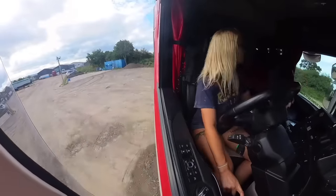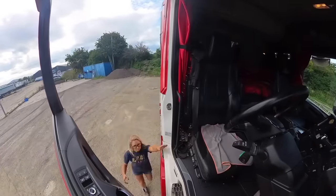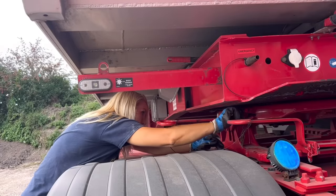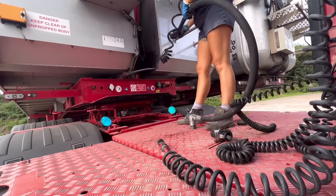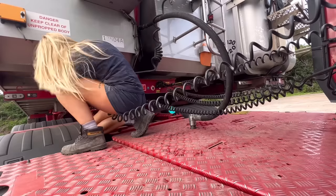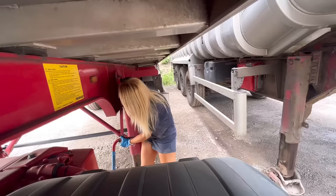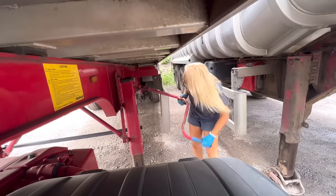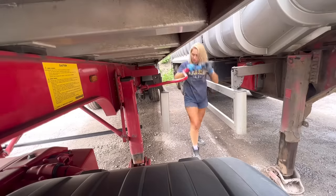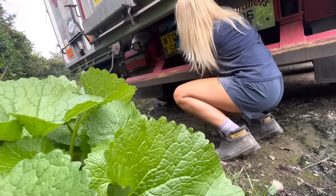I find my trailer at the yard that I dropped this morning, and although you can't see it, it is definitely behind me. As always, I get out to check the fifth wheel height, and then I can reverse back onto the trailer. I do up the clip. I connect the hydraulic pipe and all the Susies. I've pumped the brake to reduce the air, but the red line on this one always seems to be a little bit stubborn — but it will go on. Then I wind the legs up. I've never realised this until I watched the video back this time, but it looks like I'm rowing a boat. Then I put my number plate back on.